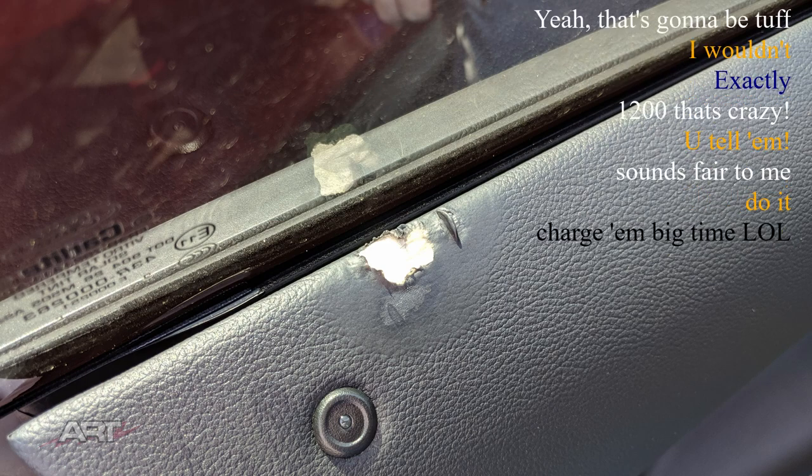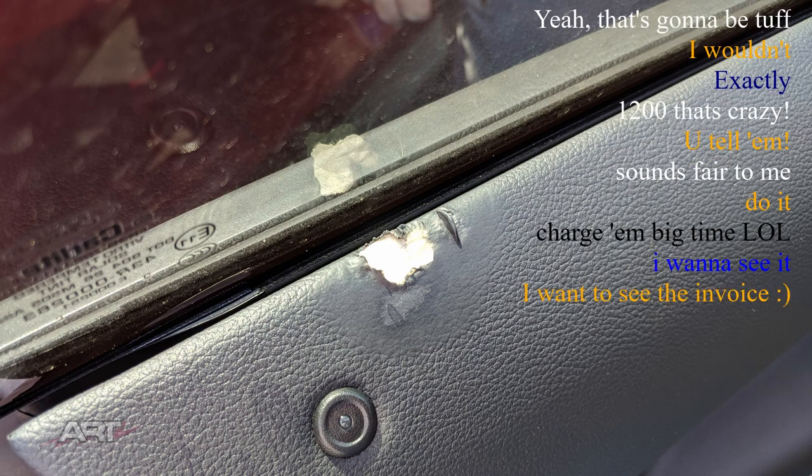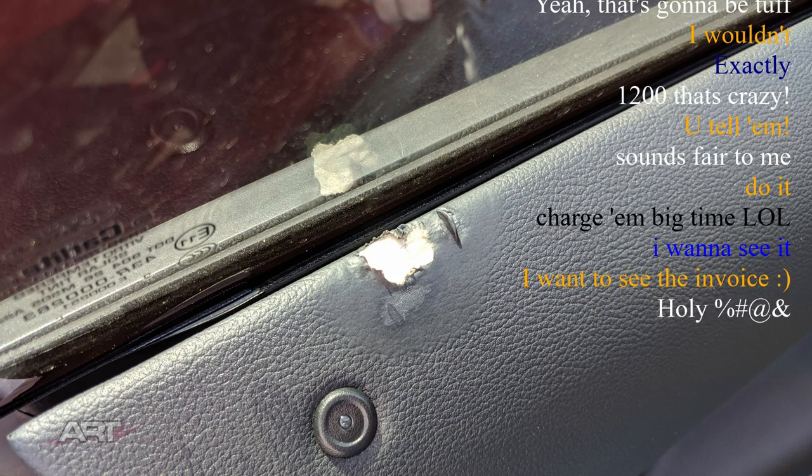Well, if we thought a vinyl heat repair would work on this door panel, we need to look a bit closer at the vinyl immediately around the damage. See how the grain or texture has bled out due to the heat? So doing a hot repair would do more of the same, and we would only make that flat area wider. Also, the contour will have to be absolutely perfect, and that would be better accomplished with a cold repair that could be sanded.